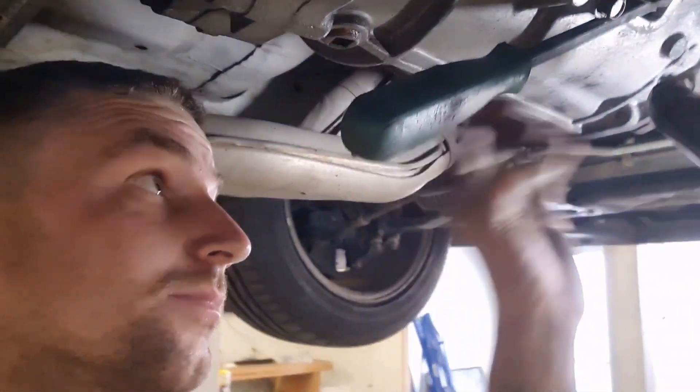That was the most stuck crank bolt I've ever had. I used impact power bars, I tried rattle guns, I tried everything. I ended up blocking the crank off the flywheel through the clutch boot hole and then put a pole a meter and a half long on it — that's what finally loosened it. I guess that's what you get for a 29-year-old bolt that's never been off.